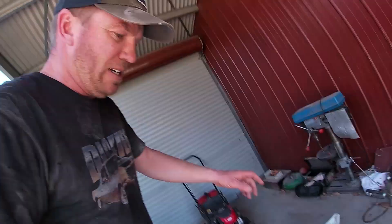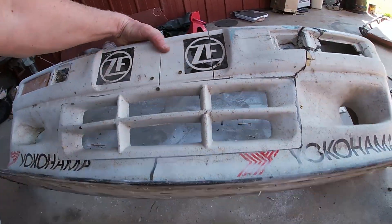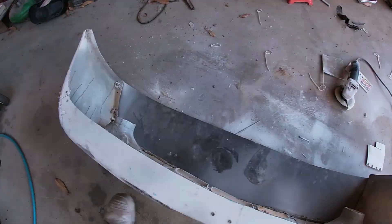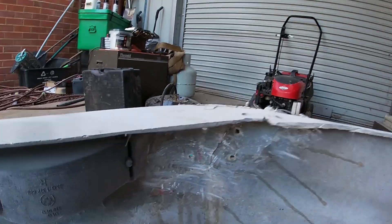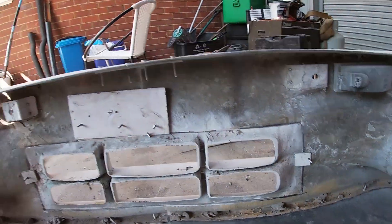Okay so I'm no fiberglass expert but here we go. This is the front end - essentially what I've done is just cut that out of the center. I split it down the center and left this in one piece, so I put that back in there. That's pretty much what it's going to look like. Now that's the splitter - my air dam that was on the bottom - you can see how much it's been shortened. I screwed it all back together just to make sure she's all good. There's a heap of other cracks I'm going to have to repair. I've just ground it all back and got myself a fiberglass kit - just going to fiberglass it all from the back, and I may need to give it another go from the front. Trim that front splitter and we should have a semi-close NASCAR front end sort of thing for the mini.